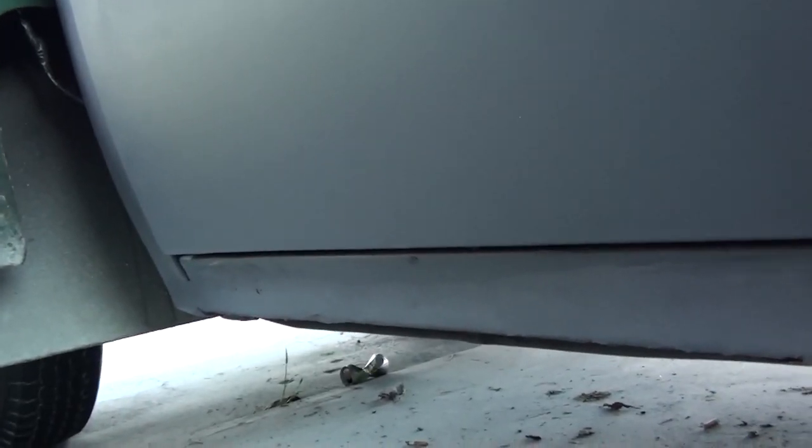You can't see much when I shine the camera at it — it's just primer and the camera has a fit with it up close; it has nothing to focus on. There's a little bit of issues back there in that door. These rocker panels — we hacked out the rust and packed them with Dyna-glass. I shot some primer over it — primer makes a good guide coat so you can see how screwed up it is. I've got it filled in, I've got it smooth, but it's by no means paint ready. You can see it's cracked right here — that's from me doing some massaging work on the fender.